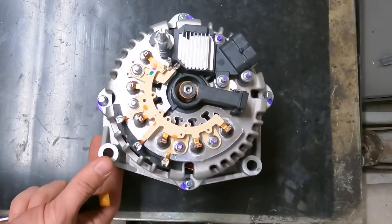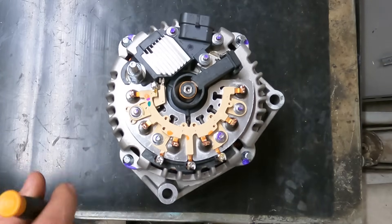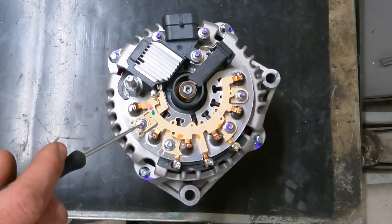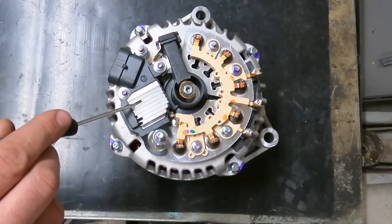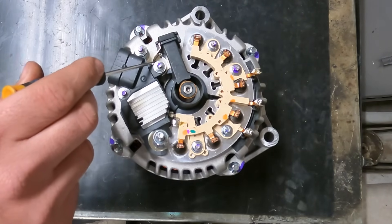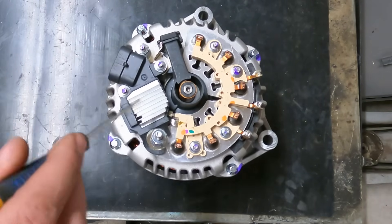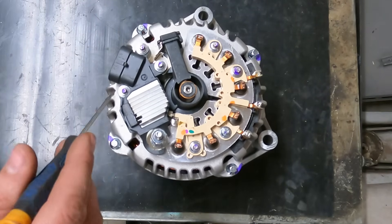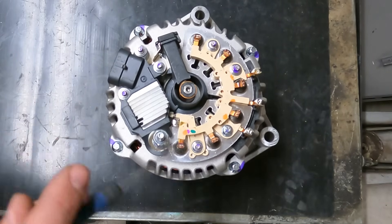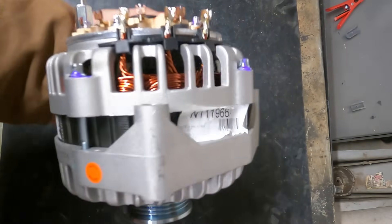I went through a few alternators on this project. What happens is the parts get too hot - specifically what gets hot is this bridge rectifier, the diodes in it. The way we're going to rectify that is by removing it completely. To do that you remove this bolt, this bolt, this bolt. This is the internal voltage regulator - we're going to remove that as well, because in order to weld we can't have this trying to regulate our voltage. We need to send full 12 volts unregulated to this positive brush.